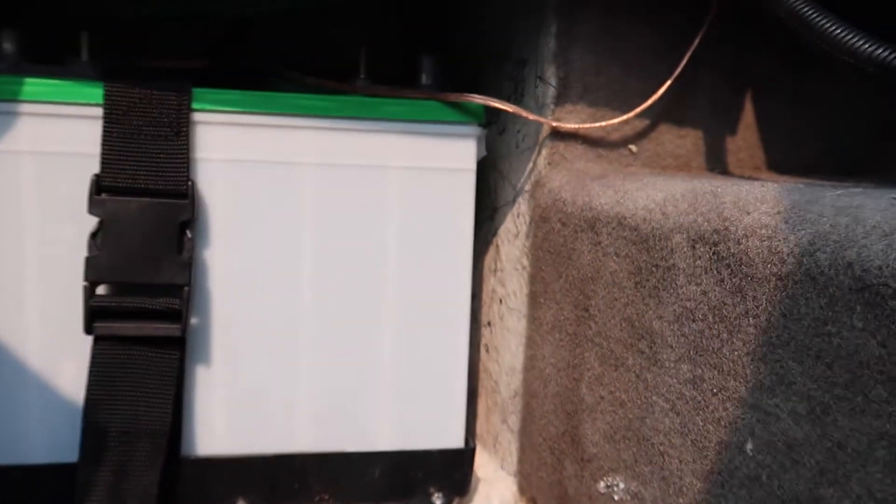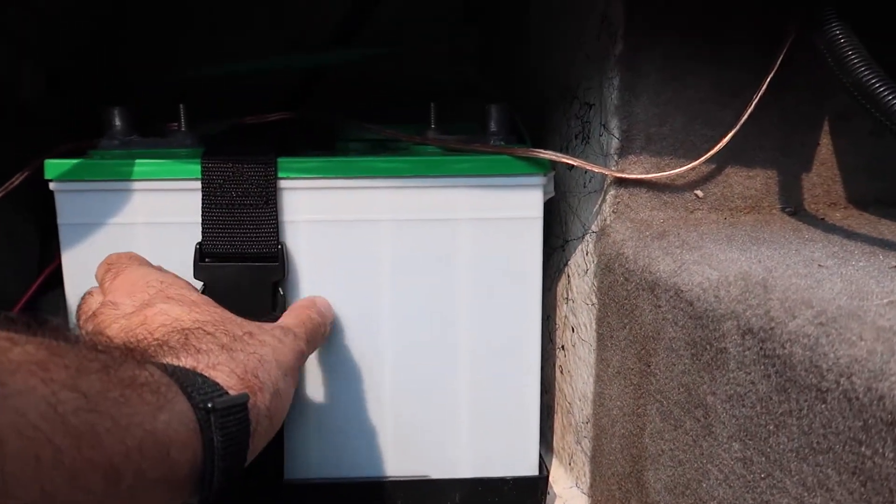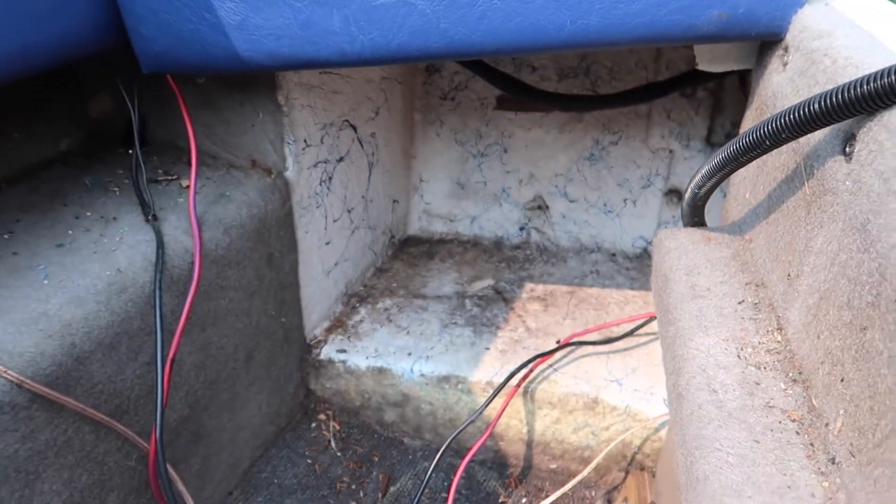What I can do is put in a piece of wood — a two-by-four or maybe a piece of plastic — to wedge the battery in so it doesn't rock back and forth. But it's in there and it's secured. What I like about this is the quick-snap release — easy to pull the battery out. Battery one is installed. Now repeat for battery two.